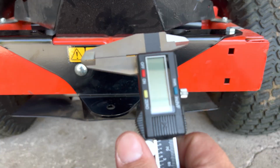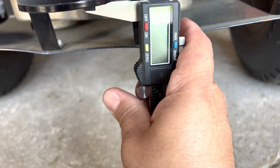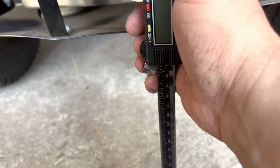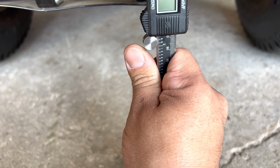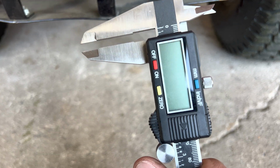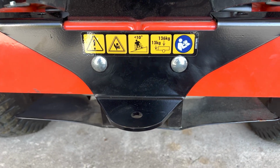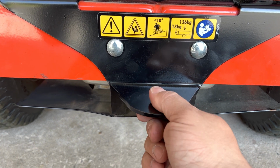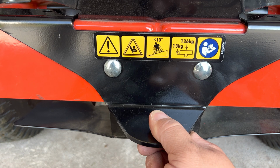I do want to show you guys, my battery died, but this is coming to about, let's see here. I usually use these with 2 hands, but it's about a little under 5 millimeters. So if you convert that over, this is about 6 gauge steel. So you're looking at a 6 gauge steel thick Hitch, powder coated, pretty strong bolts, and lock nuts.